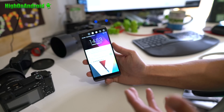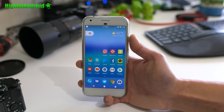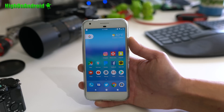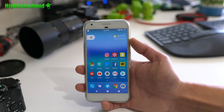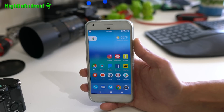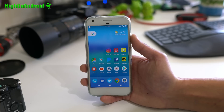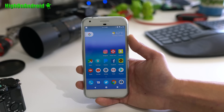Let's go install it on our Pixel or Nexus 6P. First of all, this will work on a Nexus 6P, Nexus 5X, also a Pixel or Pixel XL. Instructions are the same, but you'll have to download the different file. I will show you all of that. The first thing you want to do is put it into fastboot mode. When you install this, it's going to erase literally everything on your phone, so make sure you back up everything. You do not need a rooted phone. You don't have to unlock it — you can do it on any phone because this is stock firmware.